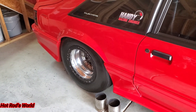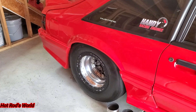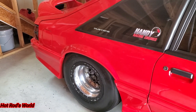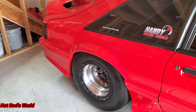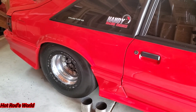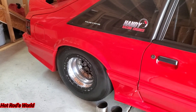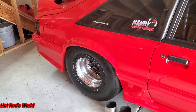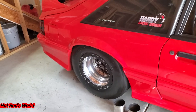As you can see, I had some anti-squat and some separation, but I remember when I did this a while back I only had about 100 to 120 percent anti-squat. Looking online and watching a couple videos — Turbo John put some up — I think I need to get my anti-squat a little higher. So I'm going to take the numbers where they are now, plot them out, and then add 30 to the numbers I'm sitting on now. It should be 30 percent better — at least in my thinking, though I could be 100 percent wrong. That's my goal for today.